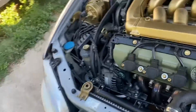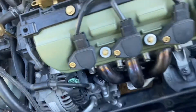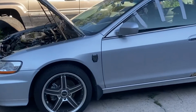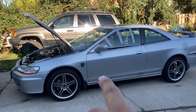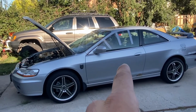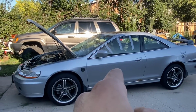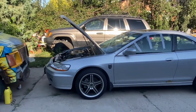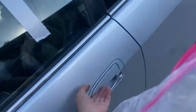Before, I knew my exhaust leak was bad when my check engine light turned off, because that meant more exhaust was going out the hood than down the downpipe. The O2 sensor that reads all the fumes and gives me the check engine code is my cat O2 sensor. So I knew there's less exhaust getting to it, and that's why the check engine light turned off. But now that it's good, check engine light back on. Alright, fan's back in. Let's turn it on.